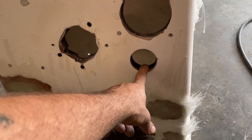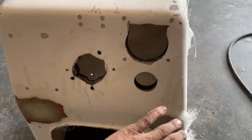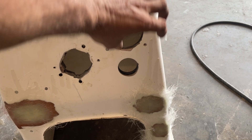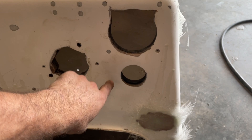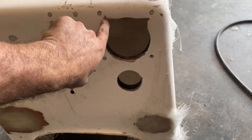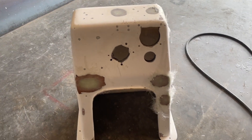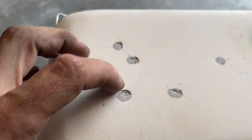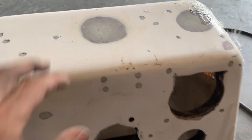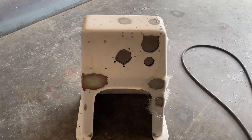I'm assuming this is some sort of factory hole from Carolina Skiff, and this was at one point a factory hole that somebody cut out for a switch panel. I'd like to do a bezel or a switch panel down the face, so I may just leave these holes as they are for now and do a nice panel that takes up this section. As far as the center console goes, it's just going to need some sanding work. I picked up some all-fair so I can come back after sanding and fill all the low spots and chip spots with fairing compound — especially here where we can see all the small holes from the chop mat.